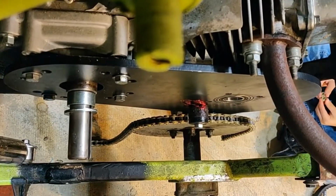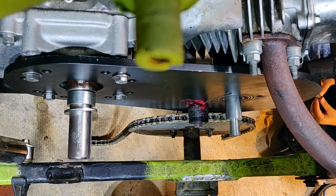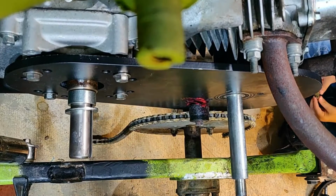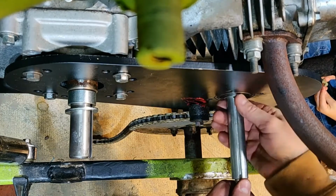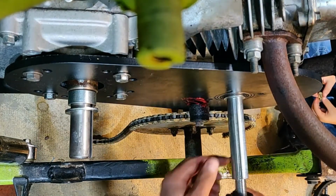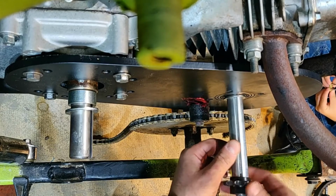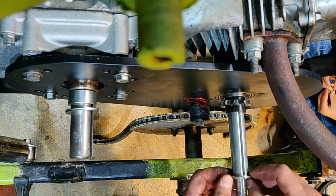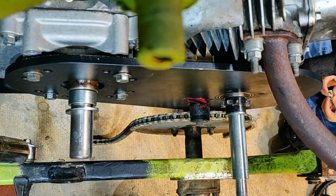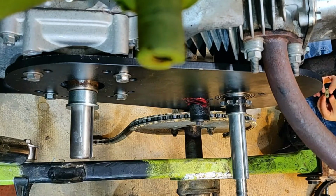I'll set you guys back up here. A calibrated camera stand. I ordered the 7/8 inch jack shaft, which is going in, because I wanted the most amount of meat on this guy there. I got 1 shim. 1 is perfect for the sprocket. You can see there's 2 thicknesses, so we've got to go with the thinner side here, so this way the motor lines up, which was completely another story, but if you got this far, your motor should be kind of lined up. Alright, so now I'm gonna put the chain on, then I'm gonna bring the video back down to show you what the tensioner is doing.